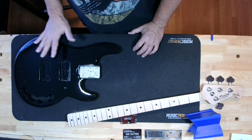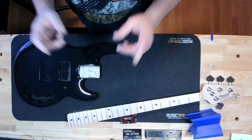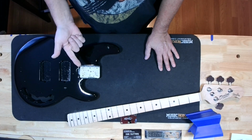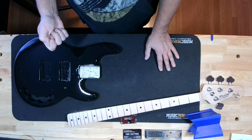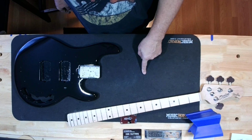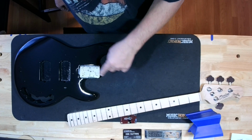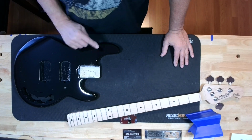Sanded it all down, scuffed the entire thing, put two really thick coats of high build primer filler. And that's important because no matter how much you feel and it's nice and smooth and you've sanded it and it's beautiful, use high fill, sandable Bondo filler. Primer filler. You can almost use any product that you want, but I used Spray Max 2K primer. I used 2 full cans on it, and the stuff is not cheap, but it's going to give you the best possible spray can result, as close to pro as possible without a paint booth, which I don't have. I did this all outside.